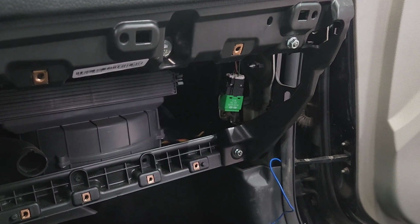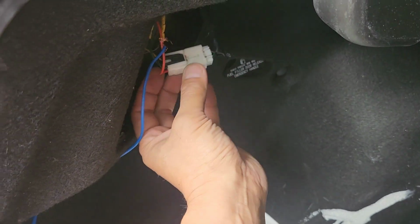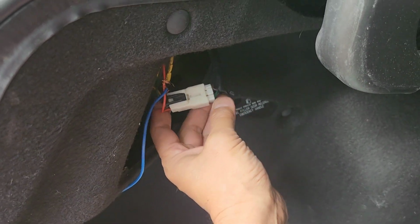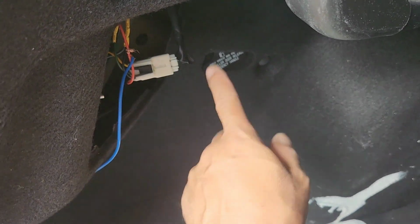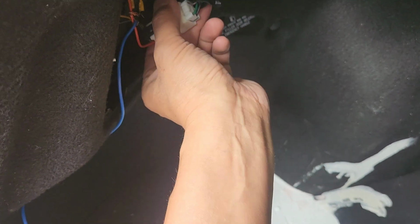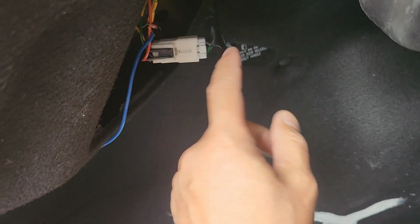But yes. So I'm gonna do a testing right there. Here's a green wire. I'm gonna do it. See, it's green, and then it goes to the plug. It's gonna be an orange wire. So I'm still doing the green wire right there. See, there's a green, there's a black, red, and then there's a blue. So I'm gonna tap this wire, a long blue remote wire, all the way to the front.